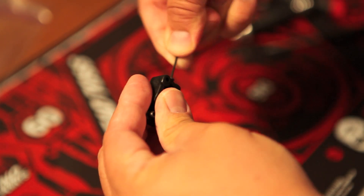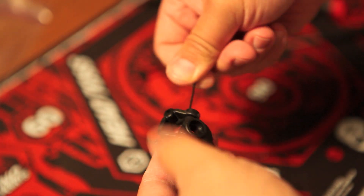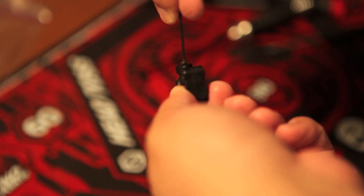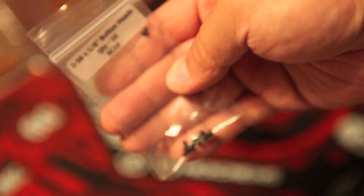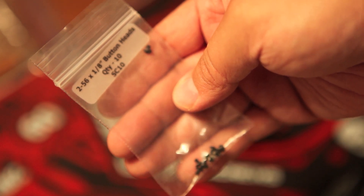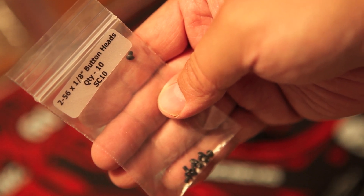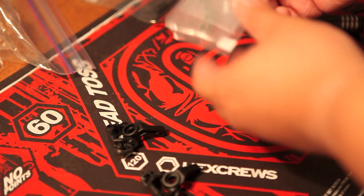I really need to figure out what screw size that is and get the right hex Allen wrench — it's really difficult threading in with the stock tool. The stock size for this screw is a 2-56 by 1/8 inch button hex head screw, and that's the size I'm using to lock in that king pin.